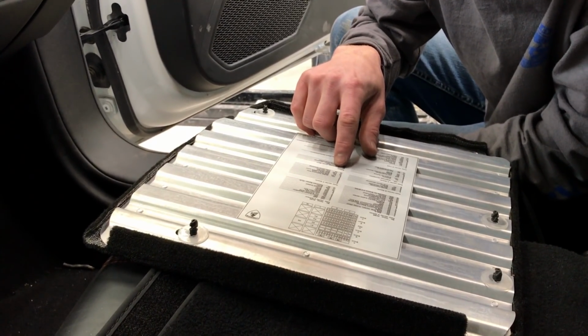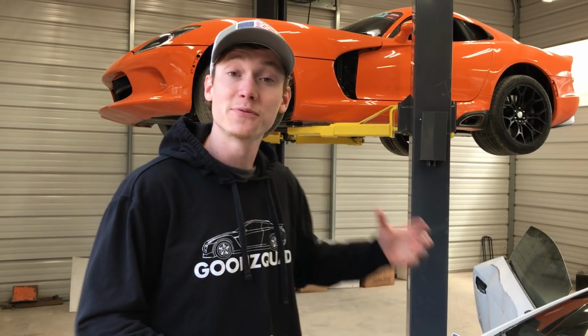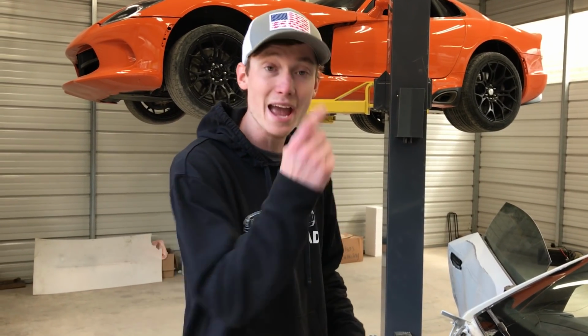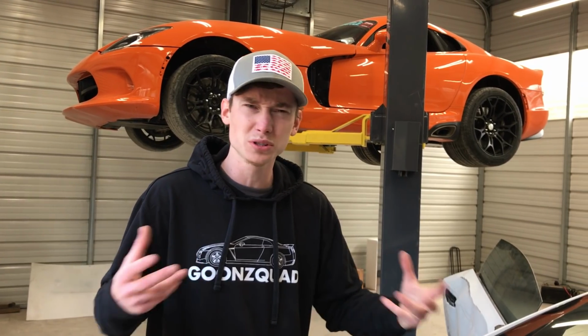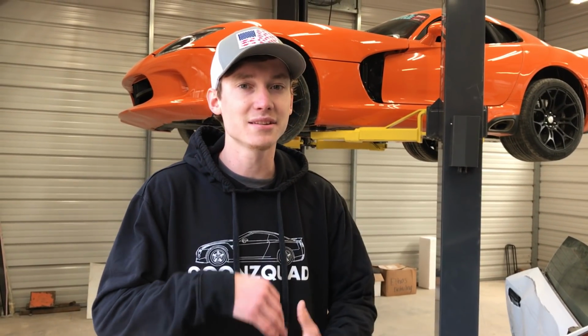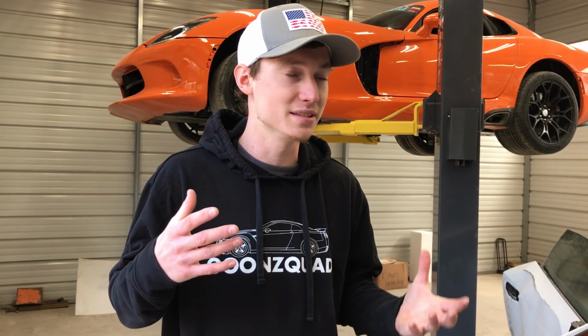So we've been moving all over the car looking for all the main electrical components like the fuse boxes and stuff like that. We actually did plug in our OBD reader right there. It's not really meant for this car, but it did read up some codes. It said something like the starter was stuck or low voltage to the starter. I think the battery died over time anyways, but yeah, it was weird how it said starter stuck. Yeah, it did say starter stuck. That's something that I never really seen before. Usually it would say starter bad or something like that.